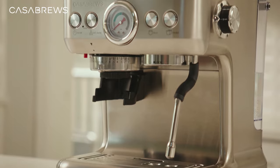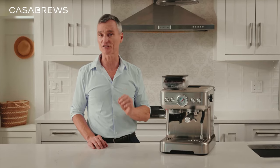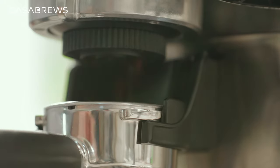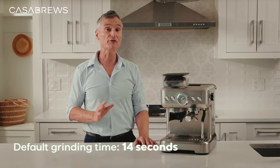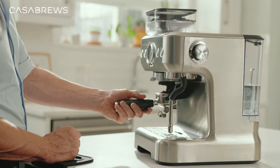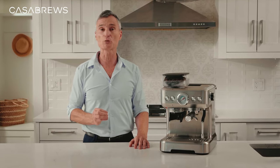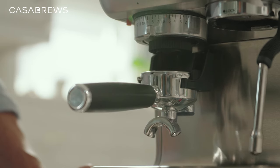But that's not all this machine can do. The 5700 Gents comes with a grinder memory function. Once you make a cup of coffee that suits your taste, the grinder remembers what amount of grinds you like, and uses the exact same grinding time for your next brew. To use this feature, gently tap and quickly release the grinding switch and it will start grinding using the memory time. By default, the grinding time is set to 14 seconds. To change it, just activate the grind switch for more than 5 seconds and continue to let it fill up to your desired amount — the machine will remember the grinding time for the current session. Once you get that perfect memory, this function will be fantastic for replicating it as much as you'd like, and it's so convenient that you don't have to keep holding onto the portafilter for grinding every time.